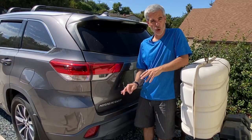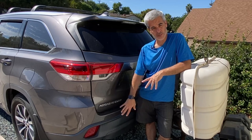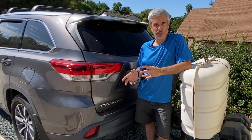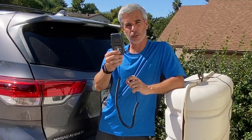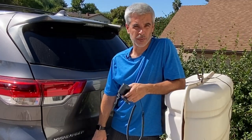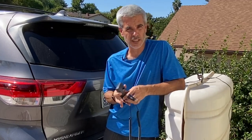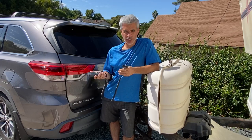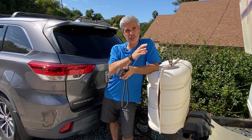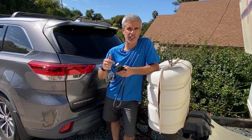That gets us to the point of having a 7-pin connector with no brake wire connected. Of course, you could run an additional wire up front, or use one of the extra wires in that cable and use that as the brake function itself if you wanted to do a hard install. What I've chosen to do is to use a Prodigy brake controller — this is the wireless Prodigy brake controller. All you do is plug this into the cigarette lighter of the car, connect the trailer. It has to have the 30-amp power and the 7-pin connector. This gives you a wireless connection both for the settings as well as manual control of the brakes. I will have a link in the description below. The beauty is the trailer can be towed by anybody — all you need to do is plug this in, and it's already tuned to the way the tires grip the road, so you don't have to adjust the brake controller for the vehicle. It's already part of the system itself.